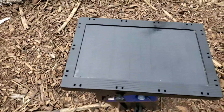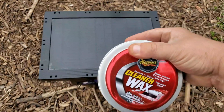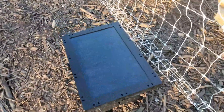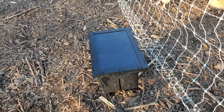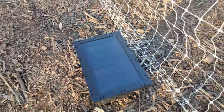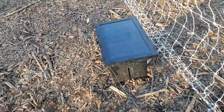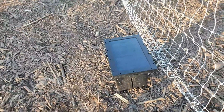This thing has been cured for a couple of days. We're going to give it another wet sand and then add some carnauba wax. As you can see, there is no more white haze anywhere — it looks pretty much brand new, except for a few fingerprints where there might be oil underneath. Now that it's back to new, the next step is to take our sandpaper and water, sand it one more time, and when it completely dries we'll wax it with carnauba wax. Easy as pie.